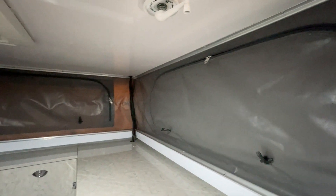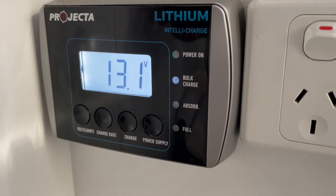It's only a small van and it's quite well insulated — it doesn't have a lot of windows, and the roof and walls are all insulated with foam. The only area losing cool air would be through the pop-top PVC, but that's up top where the warmer air would be anyway. I'm actually pretty impressed. After about 40 minutes of running the aircon, battery voltage is just hanging in there at 13.1 volts. That's the nature of lithium batteries — they hold voltage well and then drop suddenly, but we're just not seeing that dip here.